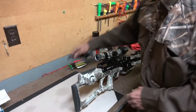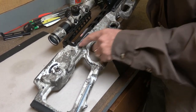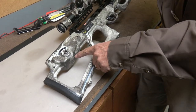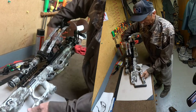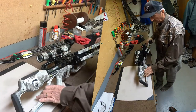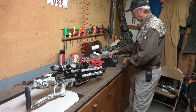There's a series of bolts that hold this part of the stock — it's a separate piece from the bottom half. There are five screws that are all the same and then there's a screw down here that is different. These are all Allen screws, and this is a T15 Torx screw. You also have two Allen screws in your recoil pad or buttstock. I'm going to zip these off using an impact, but I don't recommend using an impact to tighten because this is a composite stock and you would strip out the material.